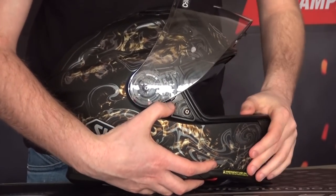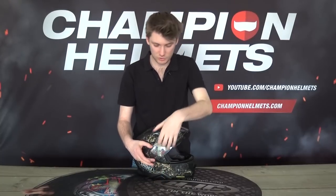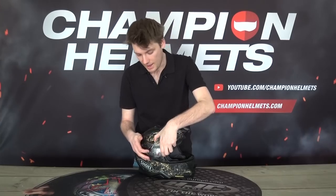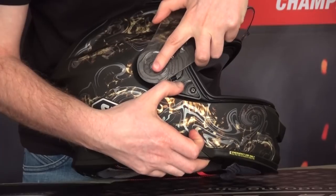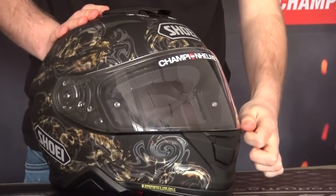You can see the spring in here. To take it off, we're going to pull down on this little thing here, then lift it up, kind of unseat it, and pull it off. It can take a little bit of force, but try to lift it and pull it in this direction because you want to pull that spring and give yourself some extra room. To put it back on, it's the exact opposite — seat this section here, put it on in the same motion, then pull it across and it seats everything and closes. It can take a little bit of practice.